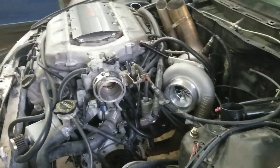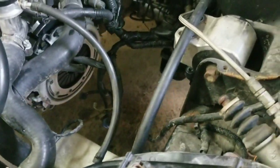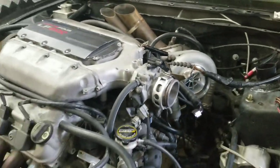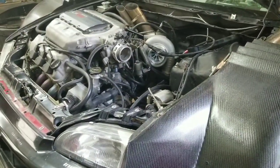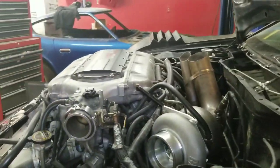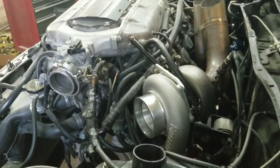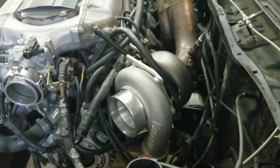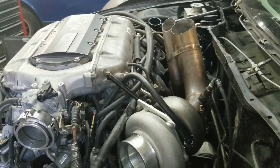There's a rear intercooler which goes in after the transmission, which I haven't yet put in because I wanted room to do this. Work smart not hard. Otherwise that thing looks pretty darn good in there — it is visibly larger, but it fits. Garrett made the footprint pretty much identical to what it replaced, so very minimal work involved. I'll get the transmission in and then we'll do a dyno test next.